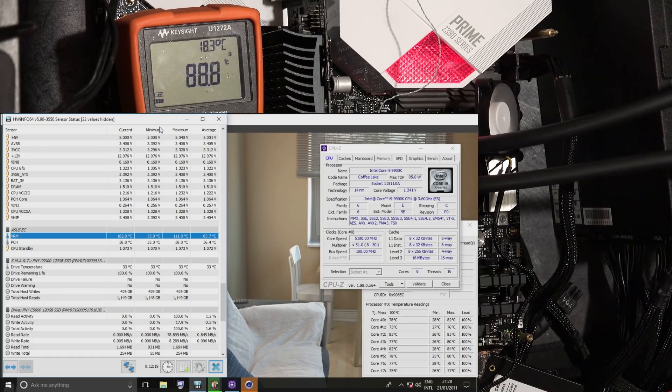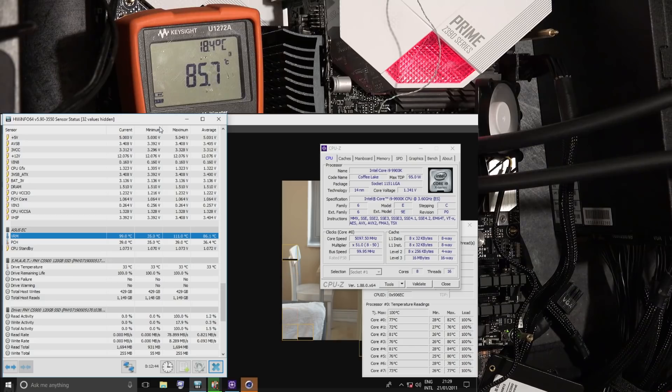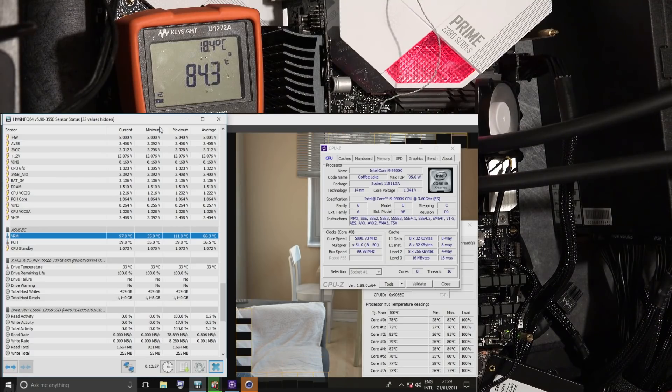It actually climbed up to 3200 RPM but a small fan doing 3000 RPM is really not that loud. Now we're at 100 degrees and still dropping - I would consider these temperatures completely acceptable for long-term use. MOSFETs can tolerate relatively high temperatures; it's more the components around them like capacitors that aren't really rated well at high temps - they're rated for 105 degrees but at that point their lifespan is measured in a couple thousand hours. A little fan on your VRM makes a massive difference.